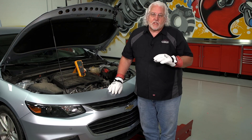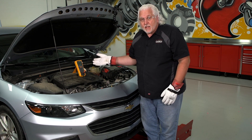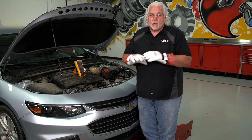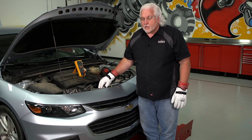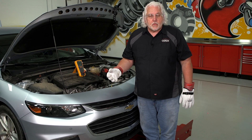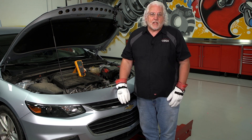I hope this helps you techs out there understand what the insulation test is and what it involves. The equipment needed — you'll obviously need this meter and your protection. Do your other tests first: your service disconnect, your live dead live — make sure the circuit is dead. Then you can go ahead and do your insulation test. I'm Mark Kenney with Garage Gurus. For more helpful tech tips like this, subscribe to our YouTube channel, and for more information on Garage Gurus, go to garagegurus.tech.